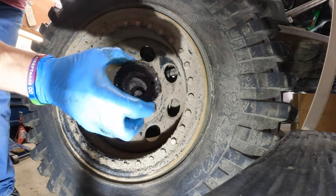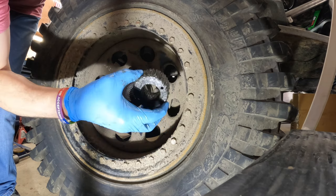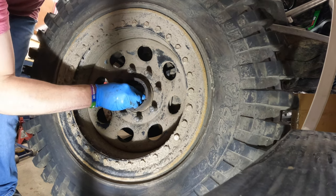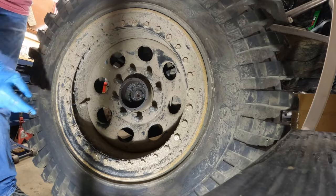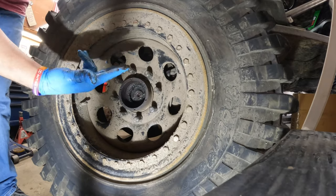All right, so we're installing the East Coast gear kit. Now, what they have is a bolt, little threaded holes to help pull this out if you ever need to. So you want to make sure that those are threaded out. And basically, that's all you want to do. Rock the tire just gently back and forth, get everything lined up, and now we're fully locked all the time.